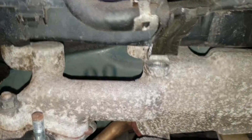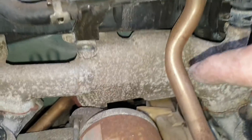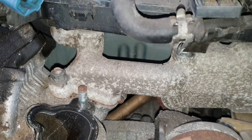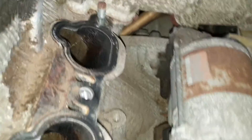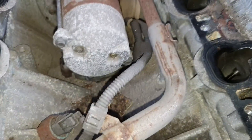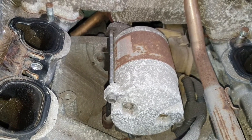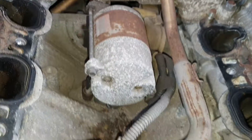What you find is that this fuel pipe here is bolted onto that water bridge there, so you have to undo that and move it back so you can get the inlet manifold off these studs — which is nice. There's the starter motor, which of course has been absolutely fine, until I put the inlet manifold back on and then it'll pack up — that's what happens.